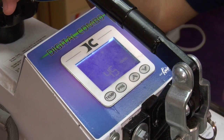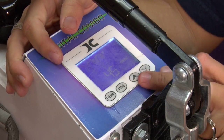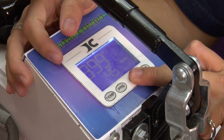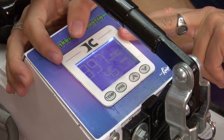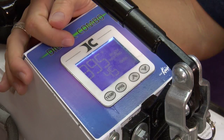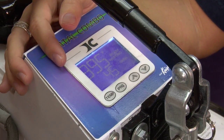Press the temperature button one time and you're going to see the temperature start to flash. What's going to flash is the actual temperature it's set at — right now we're at 300. Use the up arrow and we're going to bring it up to 400. If you hold your up arrow it'll go faster, and if you just click it, it'll increment up as you get closer to 400. Once you've set your designated temperature, press your temperature button one time and that locks it in. The screen will show the actual set temperature until it reaches 400. Don't be concerned if the temperature goes a little above 400 and drops back down — it's trying to stabilize. It should stabilize around 400 degrees, give or take a couple of degrees.